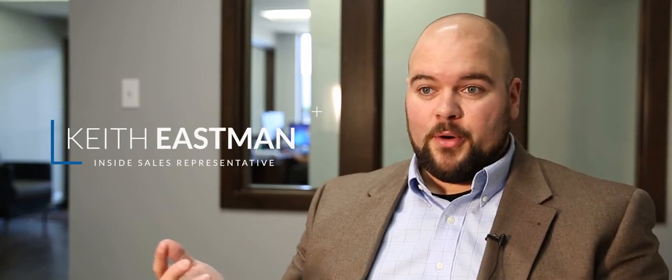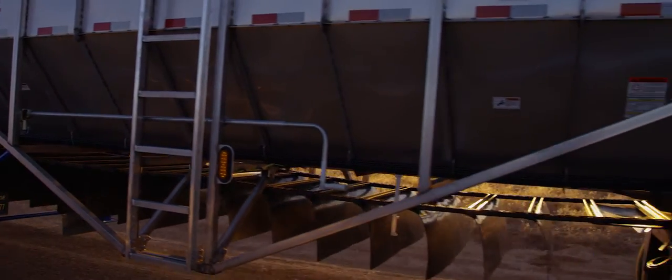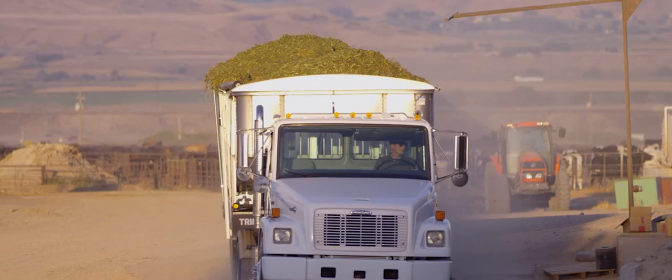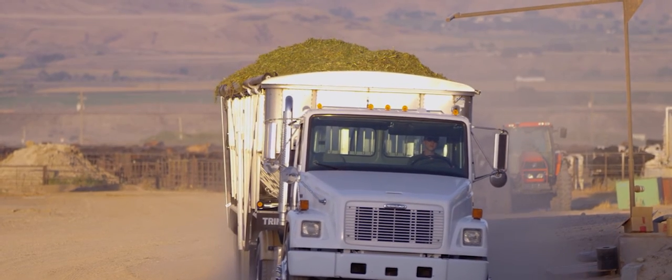The Eagle Bridge design is based loosely on a suspension bridge. The idea was that the rest of the trailer hangs down from the top rail. Not only is it a frameless design, it's got flexibility — being able to flex 18 degrees either way and come back into form without causing damage is an amazing aspect of this design.